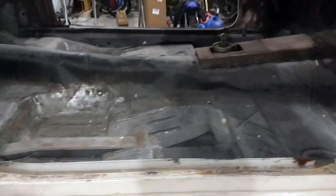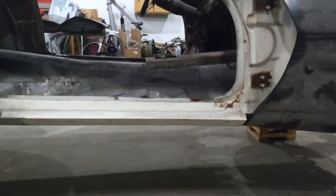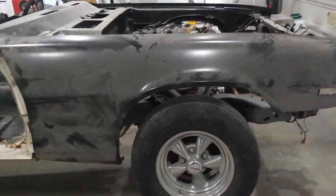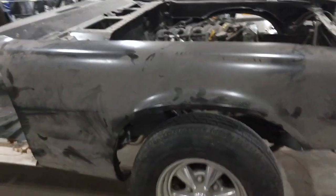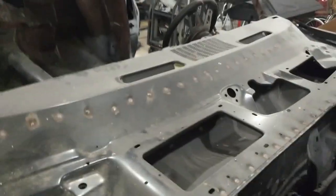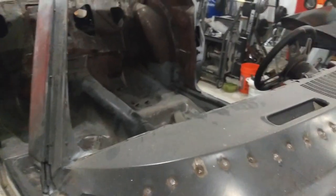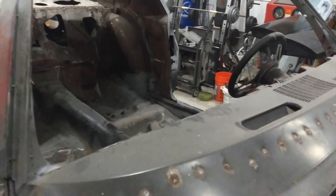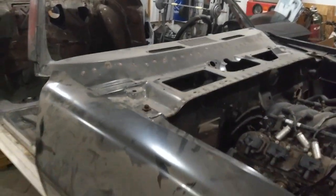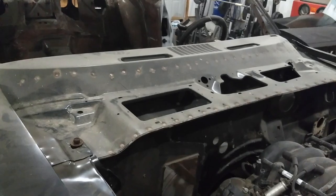Working to the middle section of the car, the rocker panel here is factory — didn't need to replace it. New fenders are on, and we'll probably have some fitment issues with those but we'll work through it. We also put a new cowl panel on — the other one was rusted. If I had to guess, this car was sitting under trees, because the sheet metal around the window was rotted out and the cowl panel was pretty well gone. We replaced it, and we still need to clean up all the welds.